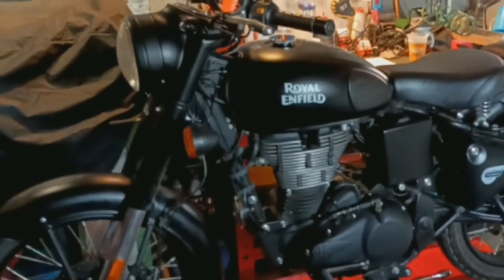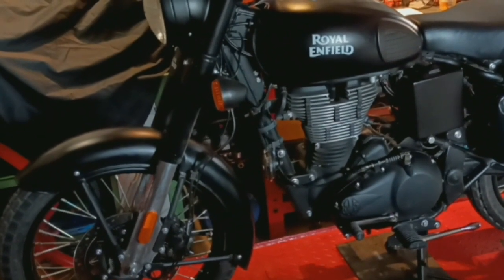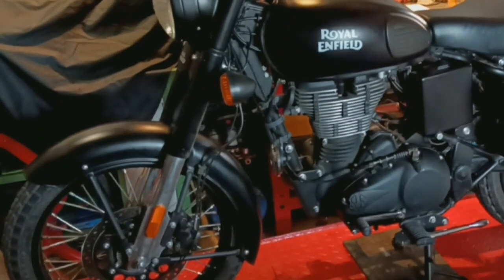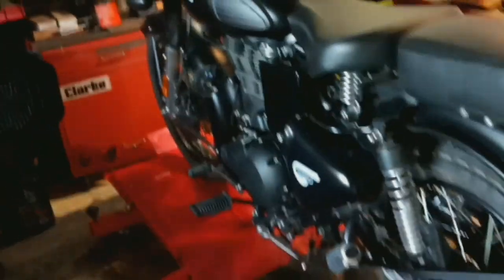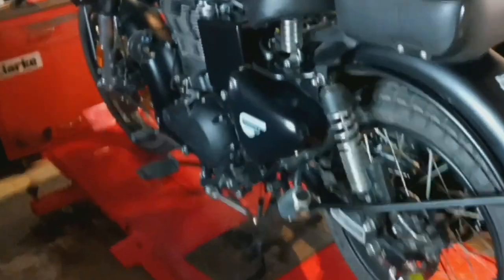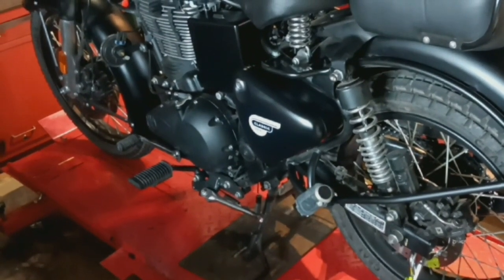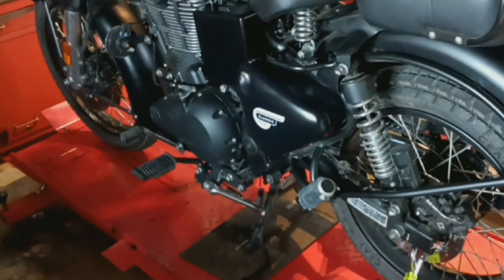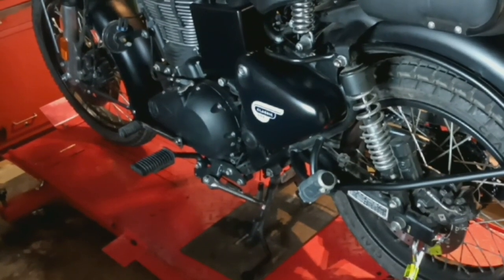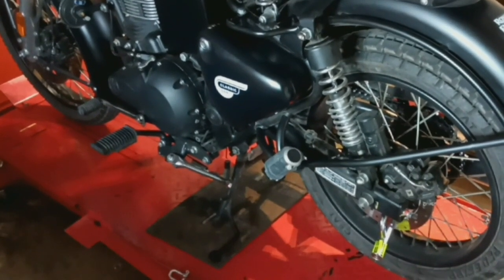This is just feedback following the test ride. I've done about 50 miles. I'm very pleased to say the rattle has gone — it obviously was coming from the exhaust heat shield. As to the crabbing of the bike, setting the wheel alignment with the tool that I made has markedly improved things. The bike still runs slightly to the right — if I take my hands off the handlebars I still have to lean slightly to the left — but it's considerably better. If any of you have suggestions for how to adjust the wheel alignment in an easier way, please let me know. Thank you very much for watching.